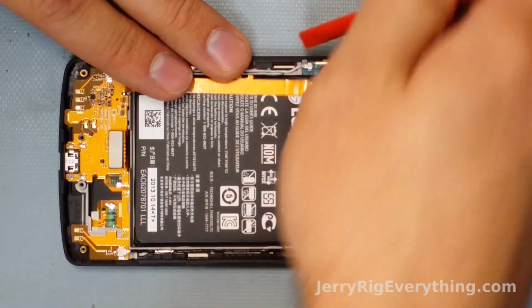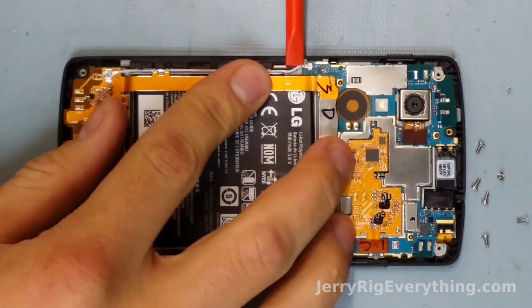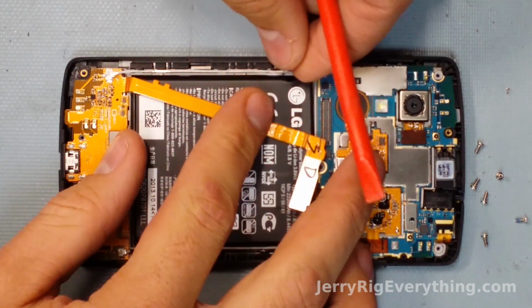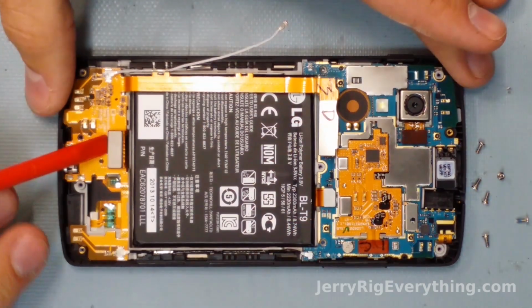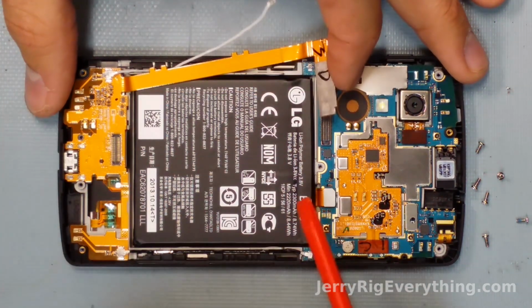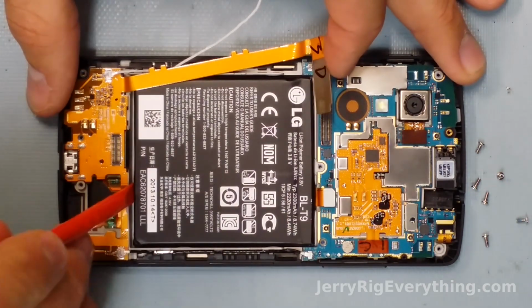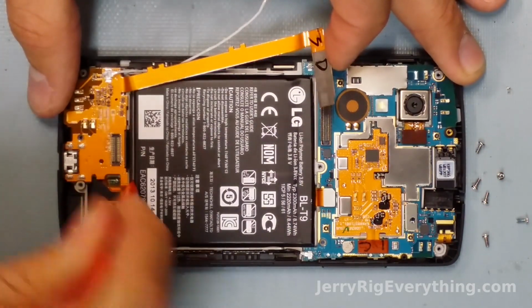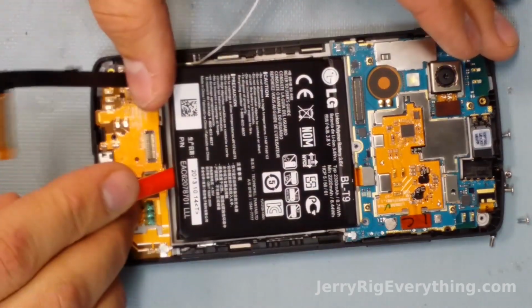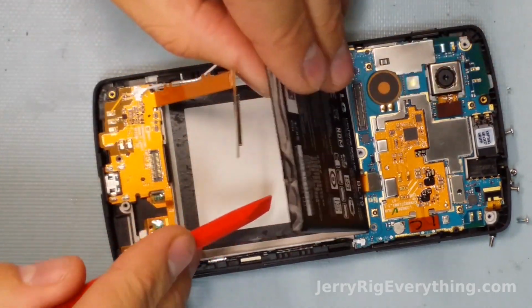This is a little wire cable along the outside as well. Be super careful when you're lifting this up. I kind of lifted it up around the base of the head of the wire cable so it wouldn't bend or break the head of it. And there's another ribbon cable latch right there, kind of like Legos, just unsnapped it. To replace the battery, you just lift up at the bottom, and then there's another little ribbon cable that attaches to the motherboard. Super simple.